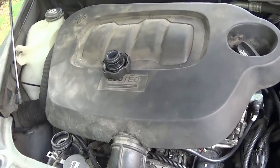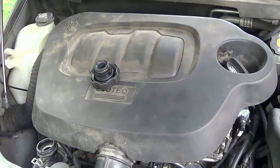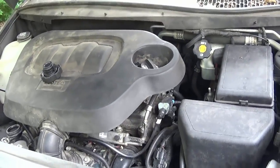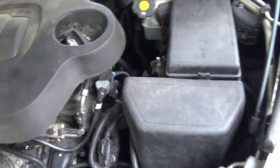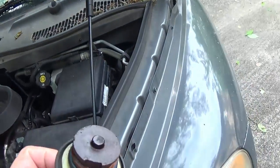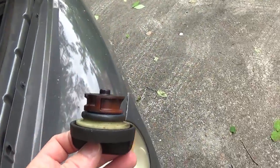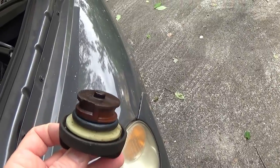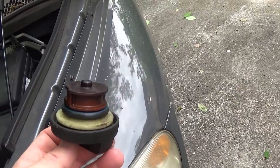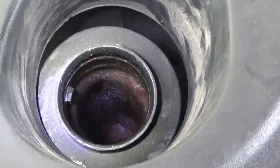There's also checking the oil cap. When you pull an oil cap off it should usually be oily. If you pull it off and the o-ring is not oily, that's a sign of a problem. In this case the car has been running water inside the engine - the cooling system is leaking over into the oil, causing it to actually burn dry looking.